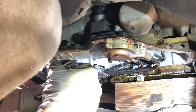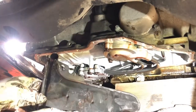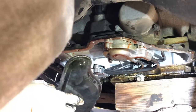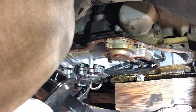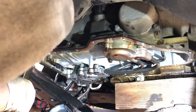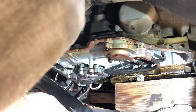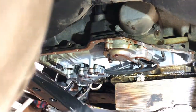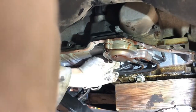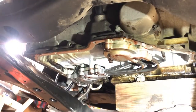Let's take a look here. How's everything looking? Obviously there's a lot of metallic and a lot of friction material, as expected for being so old. The pan itself looks to be normal — there's no big chunks, there's no shavings. I'm sure there are some particulates, but nothing big. We're going to get this off and clean this up. I'm going to make sure these hoses are tight — these are vital feed lines.